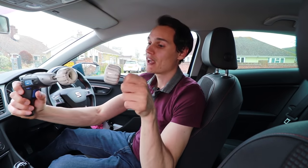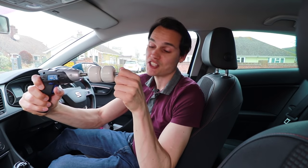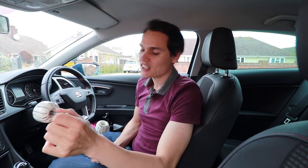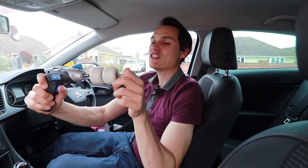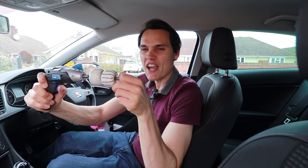On both those occasions I allowed for some clutch slippage so I could move away smoothly. You don't have to come fully off the clutch pedal for the clutch to match the speed of the engine — just holding the clutch at the bite point will allow it to match engine speed. Once it is matched, come fully off the clutch though, or you will wear the release bearing. Riding the clutch is when you lift to the bite point and don't let the clutch spin, which generates a lot of heat and wears your clutch really quickly.